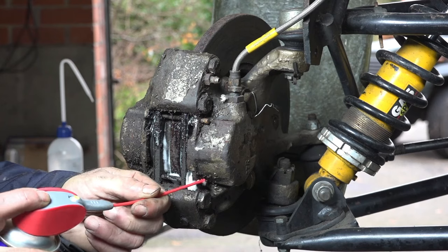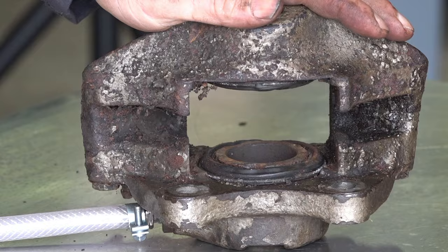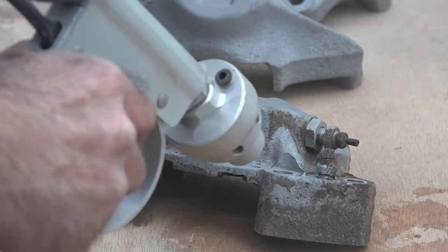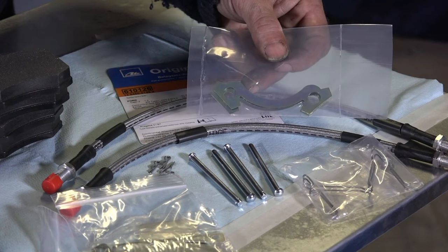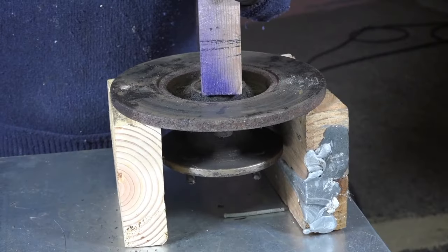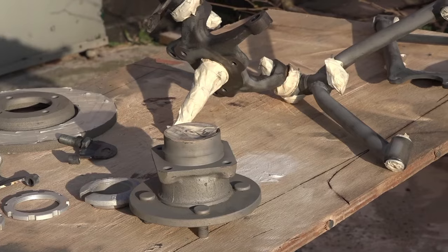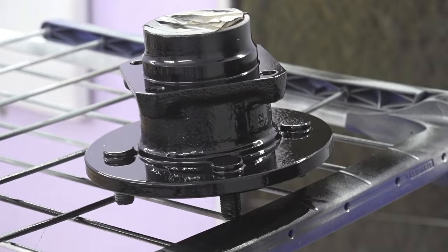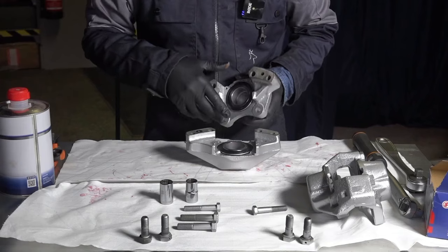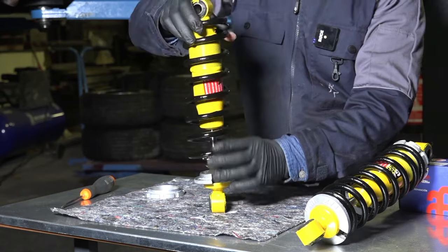Now it was time to work on the brakes, which were in a pretty poor state — they were actually seized up. I had to remove the brake pads, the brake calipers and take them apart. I decided not to buy new ones but to recondition them by taking them all apart, getting new replacement parts, shot-blasting them and putting them into a reconditioned state so we wouldn't have issues once the car is back on track. The refurbishment kit comes with new pistons and a special grease to assemble it, so I reassembled the brake calipers after they were shot-blasted and repainted.